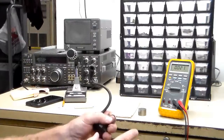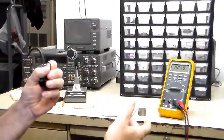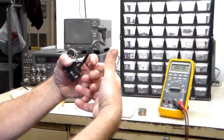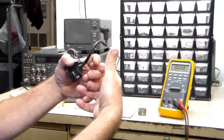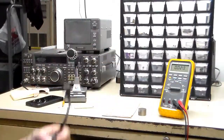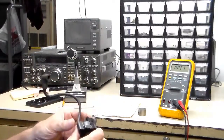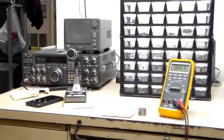It's not that it has voltage all the time — it's every time the points open that it causes a high voltage to transfer to the other side of the coil. There are two coils: primary and secondary, not physically touching. When you open and create a large voltage on the primary, you create a really large voltage on the secondary, and that's why the spark jumps over the gap in the spark plug. Same thing here, except this has a coil and the other coil is attached to this, not to a set of points. I'll show you what I mean.